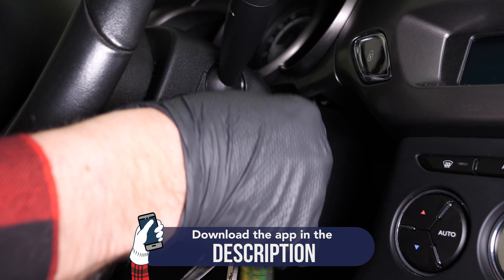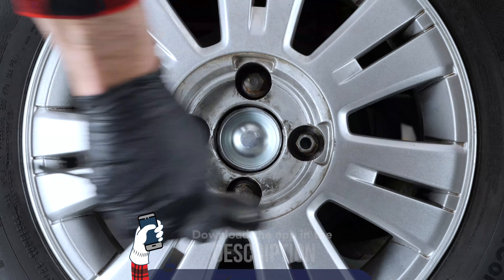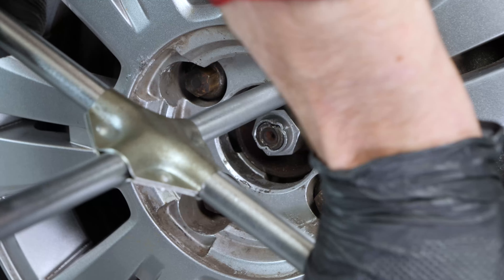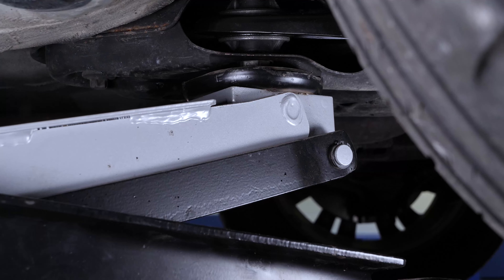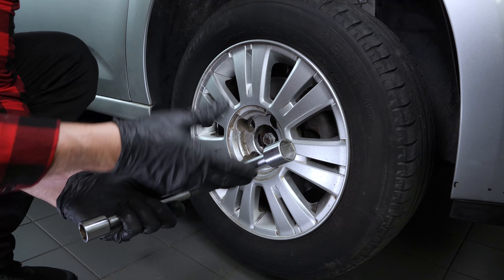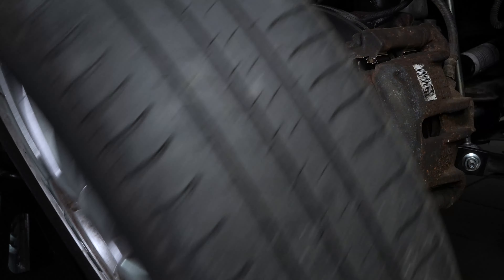Turn your engine off and pull up the handbrake. In order to change the sway bar links on your vehicle, it is necessary to lift the front of the vehicle and to remove the wheels to have complete access to the suspension system. Loosen the stud bolts on the front wheels, raise the front of the vehicle and put it on the two axle stands. We strongly suggest watching the tutorial on raising your vehicle safely before carrying out this step. You will then be able to take off the wheels.